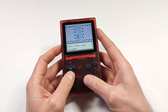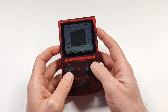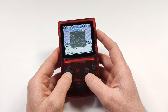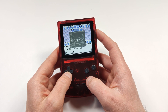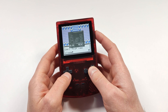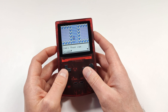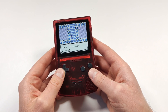To get the menu up, all you have to do is push in the side option, and you can control it with the A and B buttons. We can turn down the backlight — that gets pretty dim for night — or turn it all the way up. We have a couple different display modes: Full, 4XP which replicates the original Game Boy screen, and 4X which gets rid of those pixels. I'm going to leave it on Full. We can change the Core, and we have a couple different palettes. We have the Frame Mix, which I'm going to leave off, and we can also control the clock speed. We also have the version of the screen itself here. Clicking Save also shows us our battery levels. To get rid of the menu, push the side button again, and we can control the volume with up and down. The speaker actually gets very loud and it's very clean. When adjusting the volume, you can't hold it — you have to press it every single time, but that's okay by me.